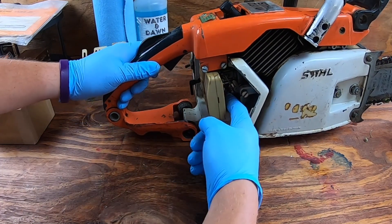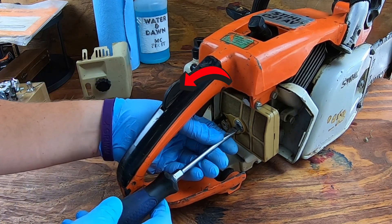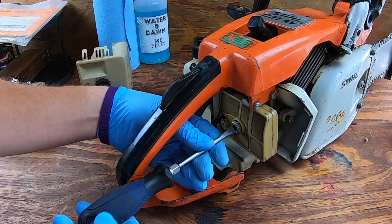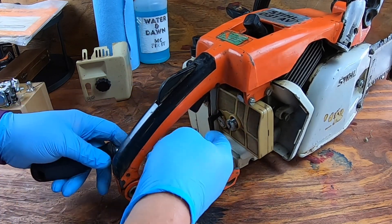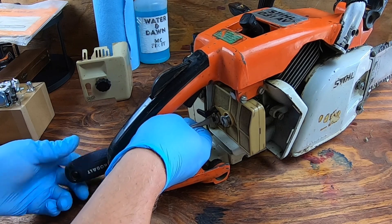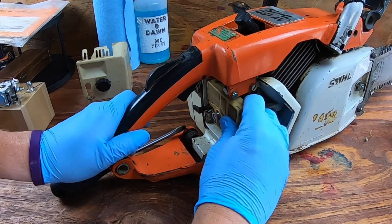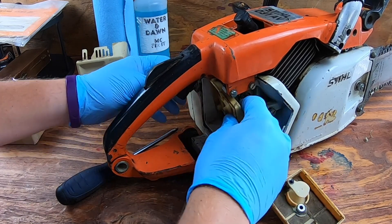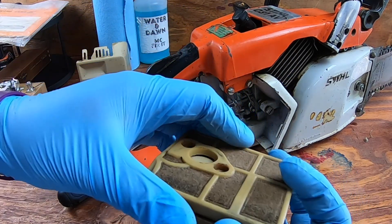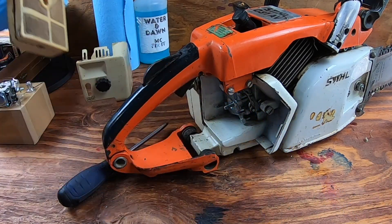You're going to see the air filter, and back here is the carburetor. To get the air filter off, it's just a flat head — unscrew it. There are two of these on the back side, and you may need to move your choke a little bit. If you have a stubby screwdriver — one of the really small ones only a couple inches long — that works really well. Move it back and forth. You can see how dirty and nasty that is. As you move the choke, it has a little mechanism inside that allows different airflow.